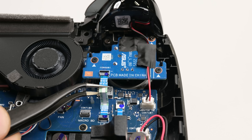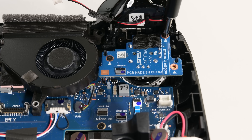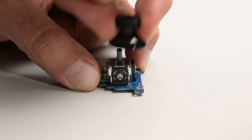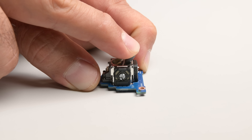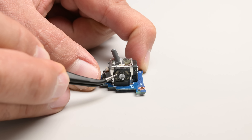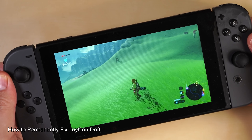I've taken the new drive out for safe keeping and we're going to dig a little deeper. On the right hand side, I'll disconnect the ribbon and trigger cables, then remove three screws holding in the joystick module. These are potentiometer sticks, not Hall Effect, which is disappointing since pots have been shown to be very susceptible to drift. If these are like all the other potentiometer based joysticks we've seen, lots of people will start to experience drifting joysticks within 100 hours of playtime. But unlike the Switch 2 where a drifting joycon might mean a lengthy repair or a new joycon, the replacement of sticks in the ROG Xbox Ally X is relatively straightforward, and with that ease of replacement comes the possibility of TMR or Hall Effect upgrades sometime in the future.